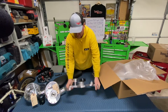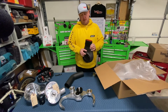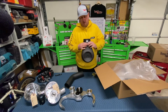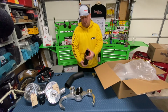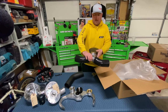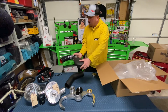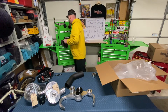All right, so let's put that one right there. Get that one set on the side. Here's that carb hat. This thing's pretty trick. And the good thing is that this is a 3.5-inch coupler. It's not a special coupler. This is a round coupler that you just kind of force on here, and it'll get a little memory going, and then you throw a clamp on here and you're good. I ordered a nice piece online just to already start playing around with the intake. I'm not sure if I'm going to have this sitting on the back of my engine, or on the front and just keep it close to the intake, or the blower sides on these two head units. But we'll mess around with this before I end today.